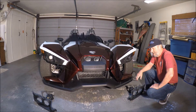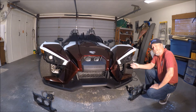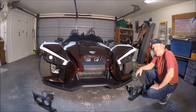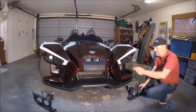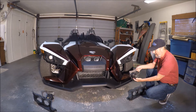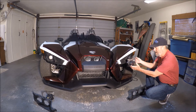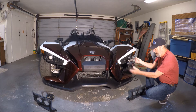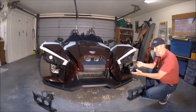Hello, Sam Owens here. Our project today is to install the Canadian style headlights on my 2017 Slingshot. We're going to show you how to install them so you'll be able to get your own set and install them yourself. We have just a few parts to deal with — a new cover for both sides. We're going to remove this cover; the assembly comes like this. The inner headlight is already assembled, and we're going to remove this headlight from this mount, install it into the frame of the Slingshot, then replace the cover and plug it in. Plug-and-play, no complications.